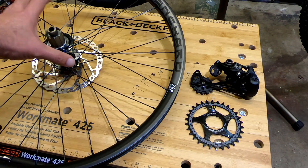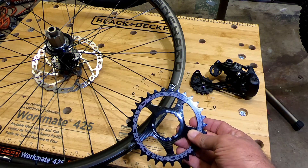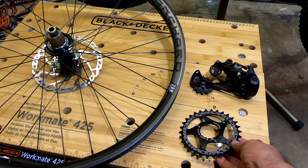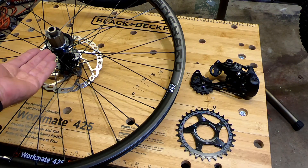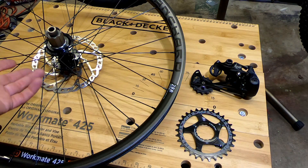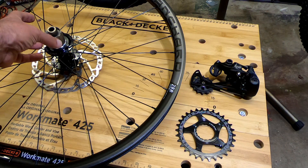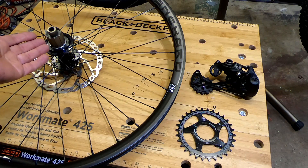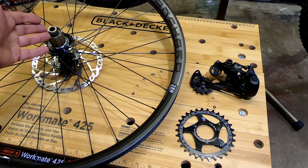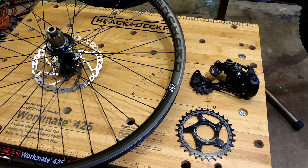So let's say you already have a Shimano SLX 1-by-10 — you can put a 12-speed cassette on there and use your same narrow-wide chain ring, so you don't have to change your crank set or chain ring. What you will need is a 12-speed derailleur, a 12-speed chain, and a 12-speed shifter, and you've upgraded to 12-speed. This could be a 1-by-8 system or a 3-by-8 system — you can do the same thing, but then you will need to change to a narrow-wide chain ring in the front.